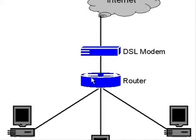With that WAN port, you're going to have four more ports to share connectivity with other computers in your house. If you have four computers, you can use the router's built-in switch to provide connectivity to all four. If you have more computers, you'll need to buy a separate switch, connect the router to that switch, and then provide connectivity to all the other computers. That's a simple home or office network connection setup.